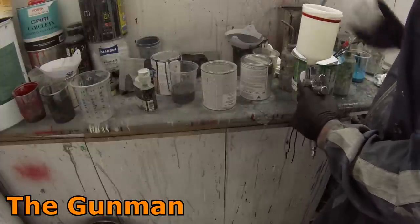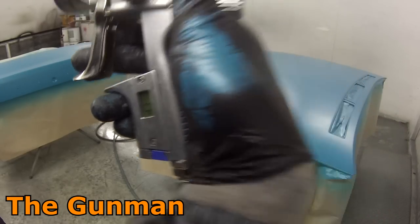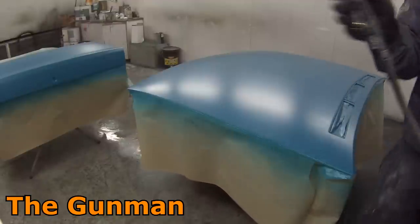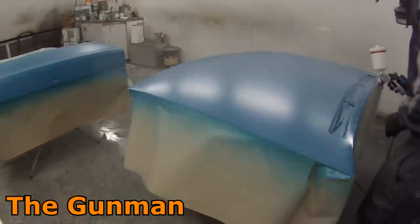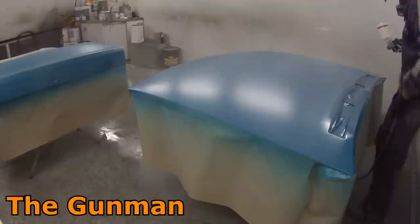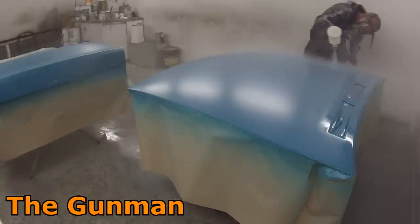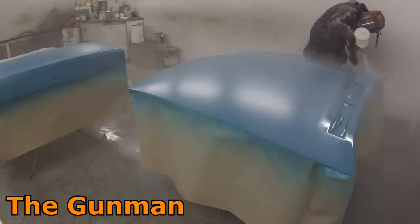Customer service is part of a company, and if it's totally crap, well that's a strike against your name. So onto the clear coats — the HS clear takes way too long to dry. Even after being baked, it stays sticky and gooey — you can put your fingernail into it after probably three or four weeks. I would not use this on a restoration job. For smash work it goes a long way because it's a HS clear and you can hammer it on real wet, but it takes a long time to dry.